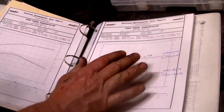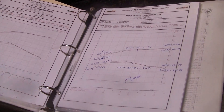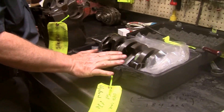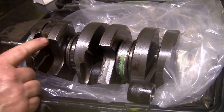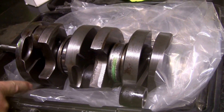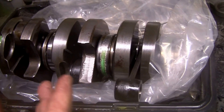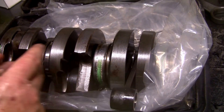If you can get a 6 or 9% gain on a little engine like this, drivability becomes huge if you can do that type of increase. Here's the actual crank, what it looks like. You put a Monte Carlo GT weight up front and a standard T weight in the back — same thing for number two, same thing for number three. The balance is still there because we're equal for all three of these sections.